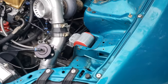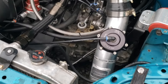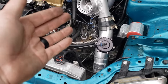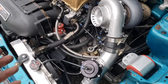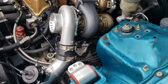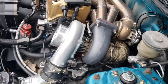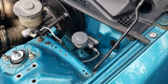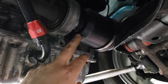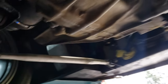On the transmission, this is a Z2M4 — out of an '03 Honda CR-V transmission. It has a Gear X one-through-four helical synchro set and RSX fifth and sixth gears. It has a competition triple-disc clutch in it, and also a DP Race Parts scatter shield, a Wave Track LSD, K-tuned shifter cables — the race spec version — and an S2000 master cylinder for the clutch with a stock slave cylinder. On the front we have Drive Shaft Shop 5.9 front axles, so we don't have to worry about axle issues on the front.